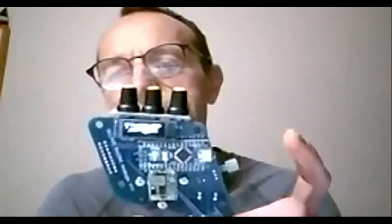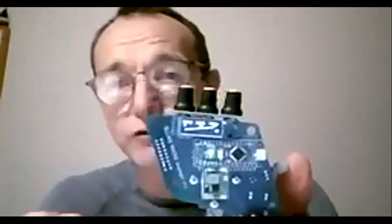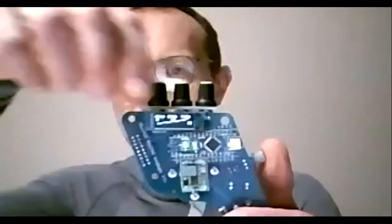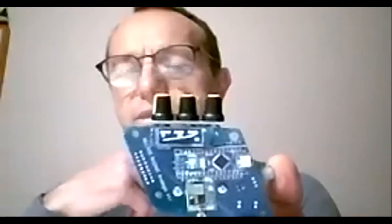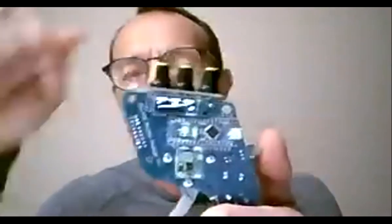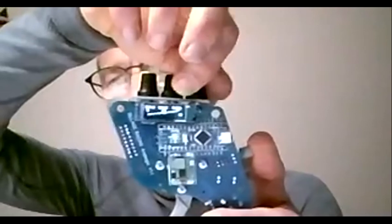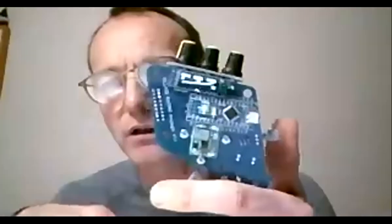There you go. Yes. And the display can show directly the curve that you explained just 5 minutes ago. When you press the button, so it's reversed for me, it's not easy. You can see that, for example, this knob is for the minimum speed. The speed for the car when you press the trigger at the first step. Okay, like this, you can adjust the minimum speed. At the end, you can adjust the turbo. I don't know in English. It's okay, turbo. Turbo. It's the last step.